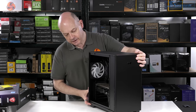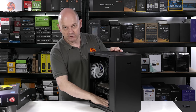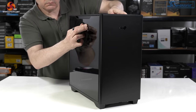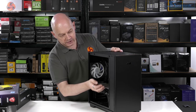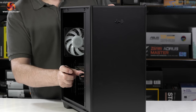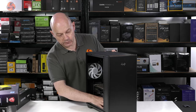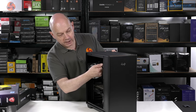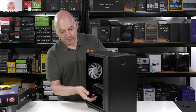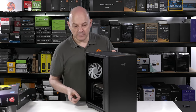You can also see that if you did have an AIO cooler in the floor of the case — against the wishes of InWin — the hoses would have to come up the side of the graphics card and go to the CPU. You have to wonder whether the clearance is sufficient to allow air to flow from the floor of the case up to the CPU cooler, passing along the way past a 250-watt or so graphics card.